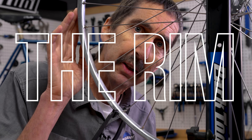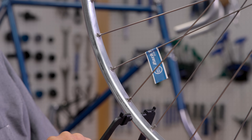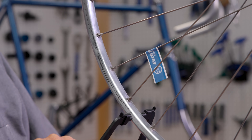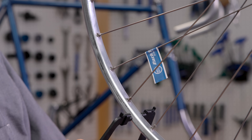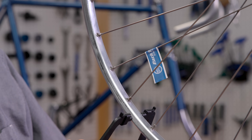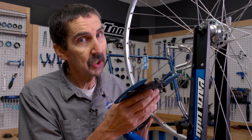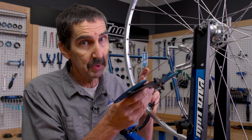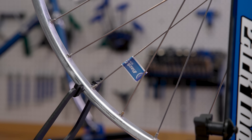As I was cleaning the rim, there are some things I wanted you to see. Right here — this is a typical type of mark from a deformed section of rim. During braking, the metal pushes back against the pads, leaving an uneven mark. Using the TM1 and the WTA Wheel Tension app, we can do a chart and see there's a disturbance in the force right here — number 12 has an issue, which is right next to this mark.